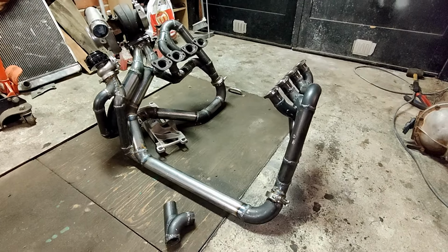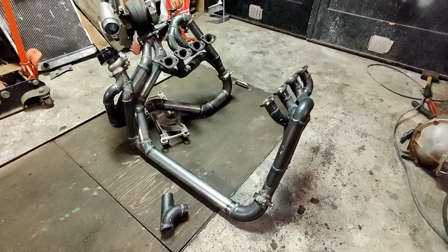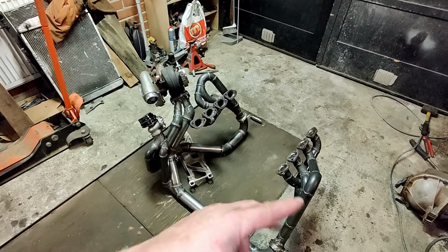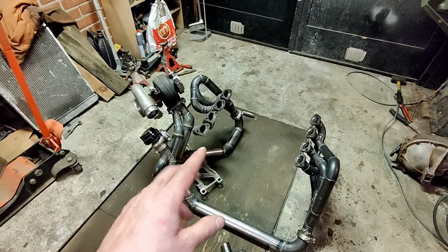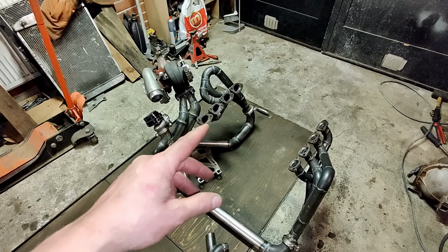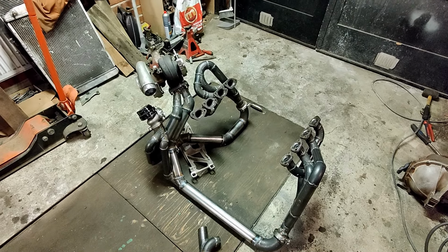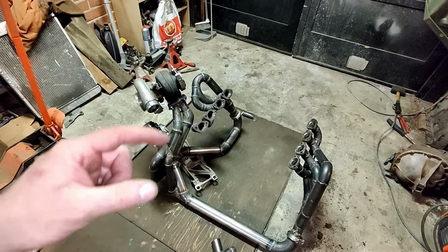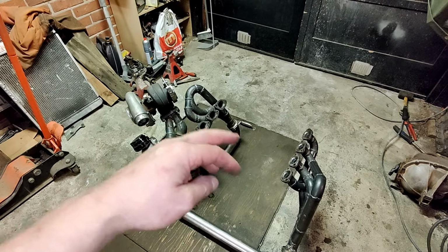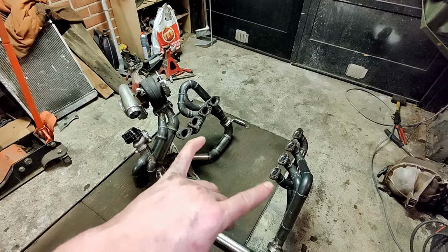And then to the actual structure or the concept of the exhaust manifold. I've built it so that the banks are separate. It's not a log type manifold, as you can see. It's like a semi pulse matched exhaust manifold, because the banks are divided so that they should have the biggest possible delay between the firing cylinders, so that the pulses would mix as little as possible with the firing order,